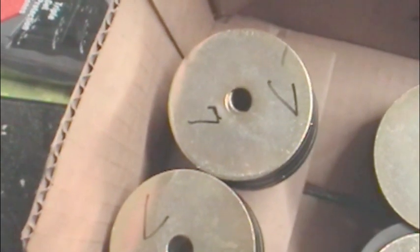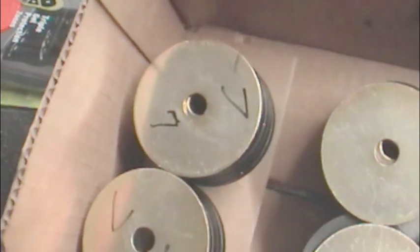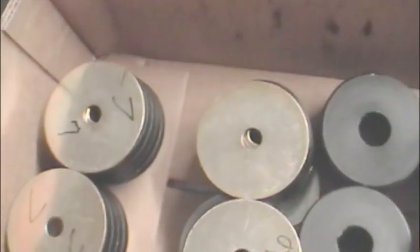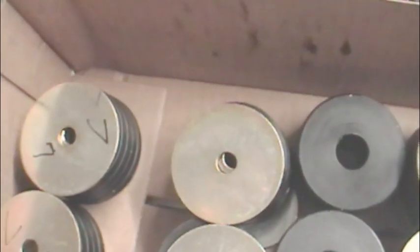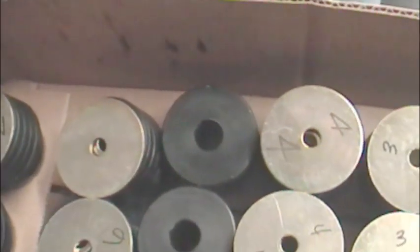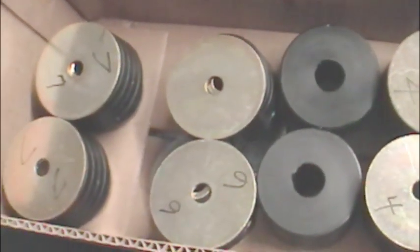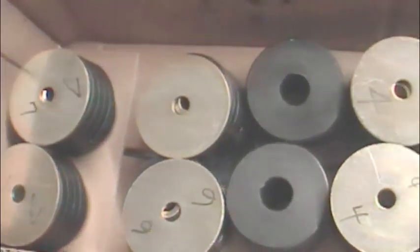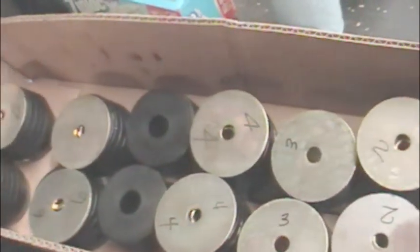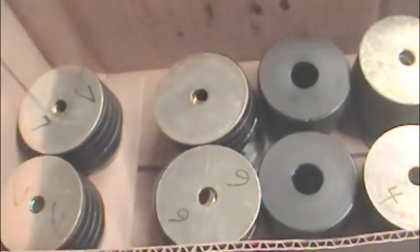You'll have to remove the bumpers because you can't move the frame rails or the bumpers — you'll ruin the bumper fillers and they're gone anyway on most any G-body example. This is — I hate to say it again — a true G-body. Because the early versions of these weren't G's. Regals, Regal Estate Wagons, and Buick Centuries were A-cars in 1978 when body styles changed. In late 1980 when the '81s came out, they evolved into G-bodies.